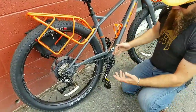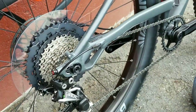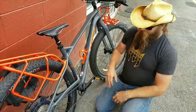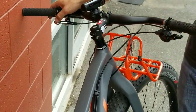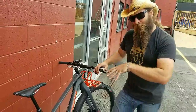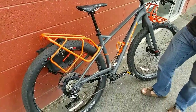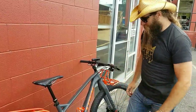There's nice low gearing on this — a 1x11 drivetrain, one gear in the front and 11 gears in the back with a wide range 11-to-42 cassette. The idea is getting the same gear range as many more gears while eliminating dropped chains and all the issues that come with a front derailleur. By eliminating the front derailleur, we also free up handlebar space for a dropper post lever, which lets us raise and lower the seat post on the fly. This came from mountain biking as a way to avoid stopping to adjust your seat clamp when changing terrain. On an adventure touring bike, it's great for getting on and off under load, navigating technical terrain where you might want to dab a foot down, or getting into your optimal pedaling position when you're spending all day in the saddle.